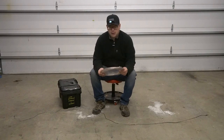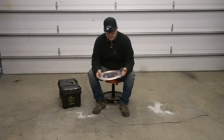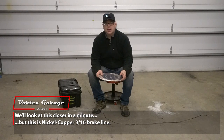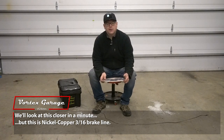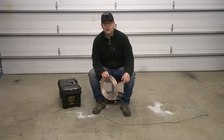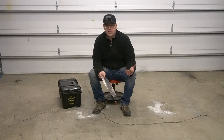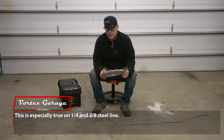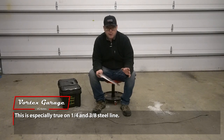What I'd recommend — I usually don't use this but this is what pretty much everyone uses because it's easier. As you've seen in our Fox Body video, I did it with three-eighths PVF coated steel line — the green coated stuff. Bending that stuff takes some effort and it kinks easily. You can screw it up; you can't really bend it back, so you get kind of one or two shots at most on your bends.